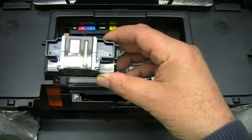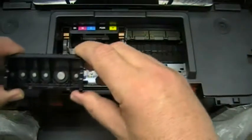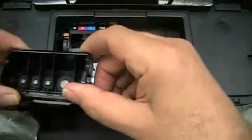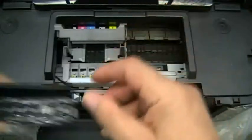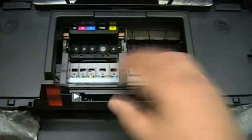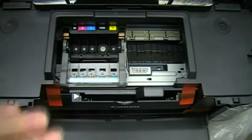At that point, turn off the tap. Take the printhead, give it a shake to remove the excess water, and wipe the contacts. To reinstall, reverse the procedure: lift up the bar, slide in, tilt, and drop the bar. That's your printhead back in.